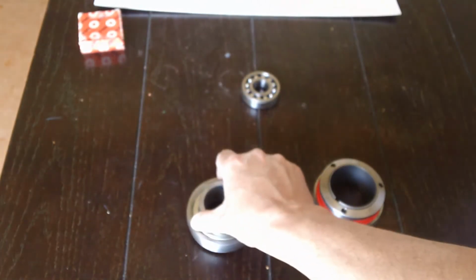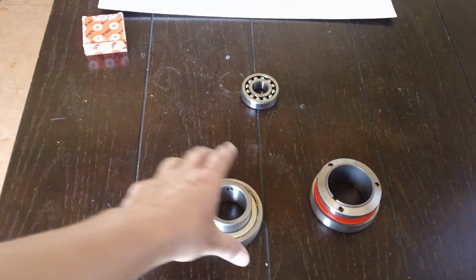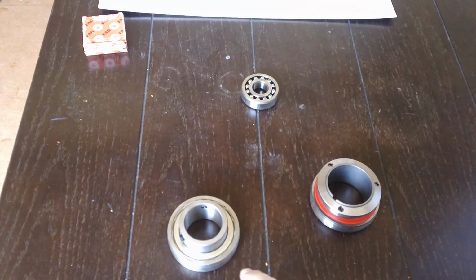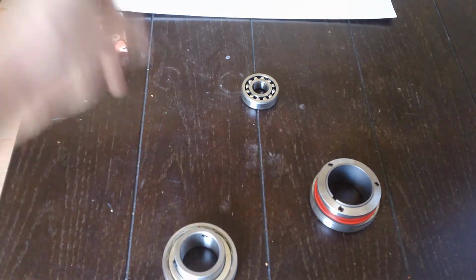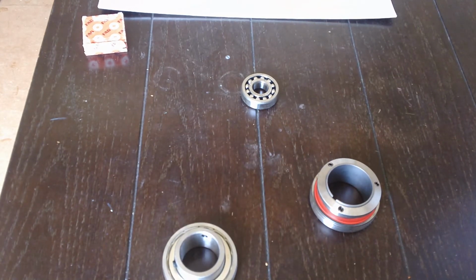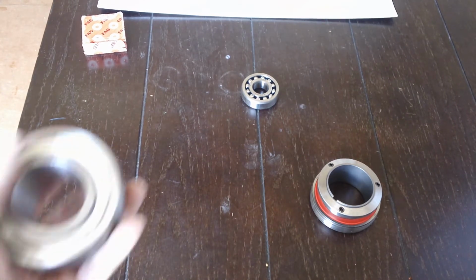So that's one example on the bearing. The other thing, you can also do it the reverse way. I don't have the axle and the bearing cassettes in front of me, but you could just measure the OD of the axle, which is the part that goes through this particular bearing, and measure the ID of the bearing cassette. That might be enough information to help the local shop say, oh yeah, that's going to be an SB208ZZ bearing. We have those in stock.